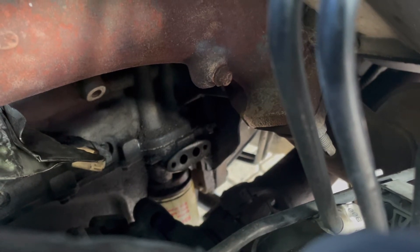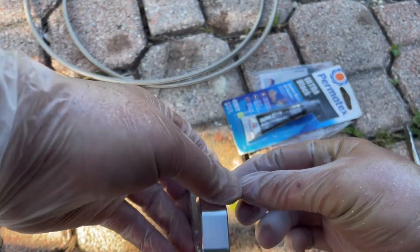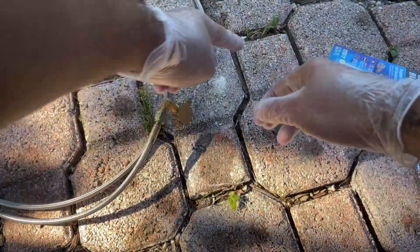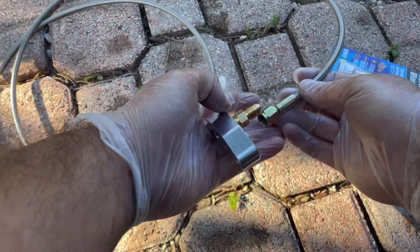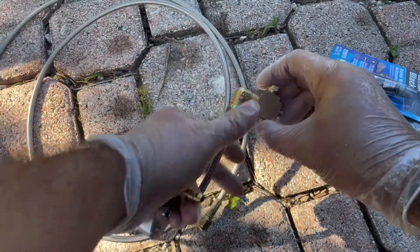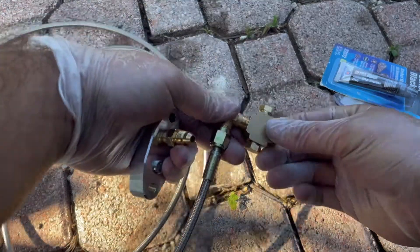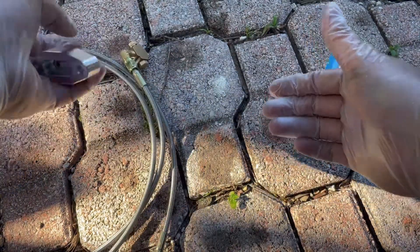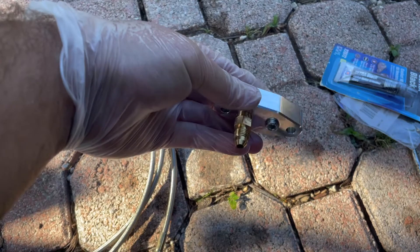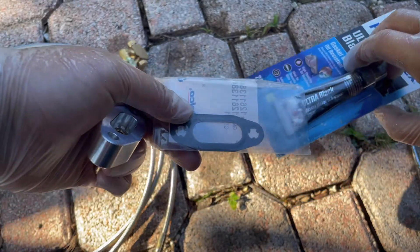Now we've got it cleaned up and double-checked that no more oil drips out. We're going to get our gasket ready and install. Here we are — we've got the start of our oil feed for the turbos on this oil block. We're going to run an oil line off of it and then up at the top of the motor run two oil lines, one to each turbo. For now this is all blocked off so we can have it installed and ready when we start the actual turbo installation. We'll use the gasket and RTV to get this thing installed.